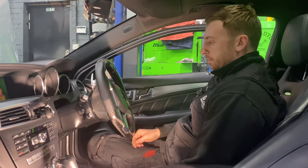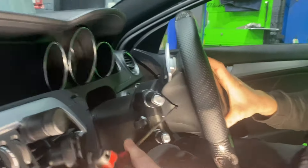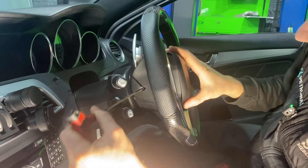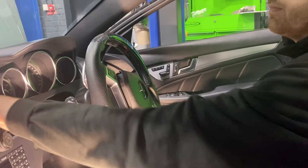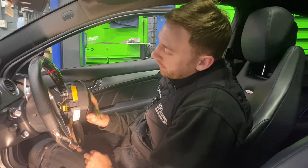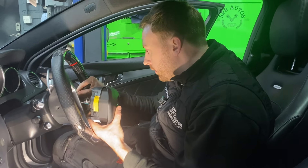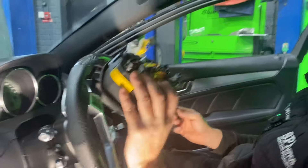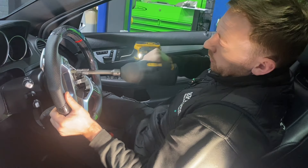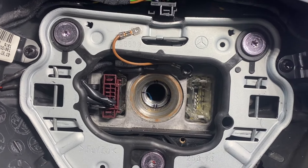Finally on to the steering wheel - should be pretty straightforward. There's a little tab in here that you press to pop the steering wheel out. The battery's already disconnected. Just got to undo this - take that out as one unit. One airbag. See those marks which line up with that bottom spline and the top spline so I know to put it back on exactly like that.